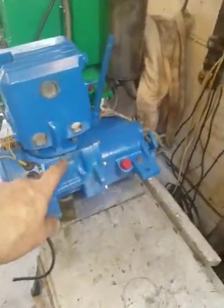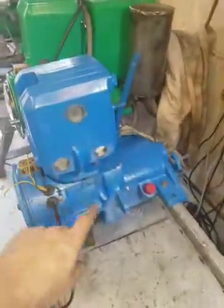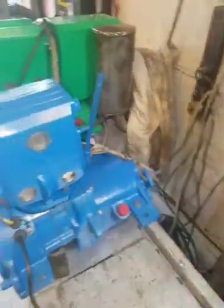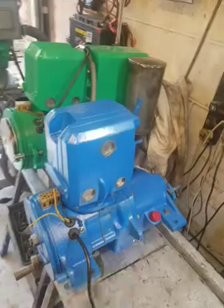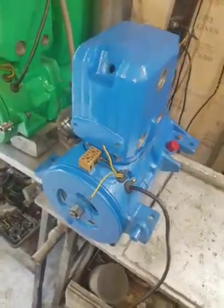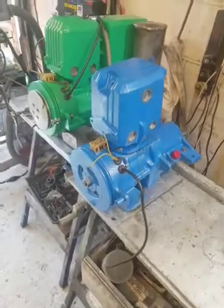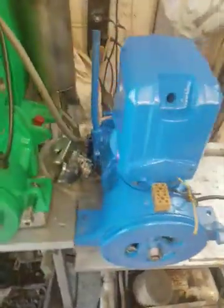This one has not got the military paint finish on like those two — that's a seven. But this I've done my own paint job and I've been quite meticulous. I've put stainless main bearings in there, stainless pump shaft of course, true crank to one thousandth of an inch. It's a really nice engine. So if you prefer blue, that one is still for sale.